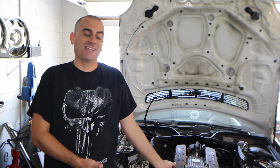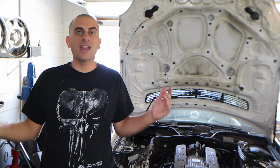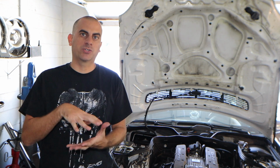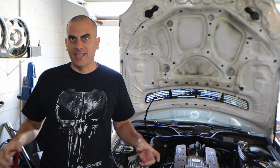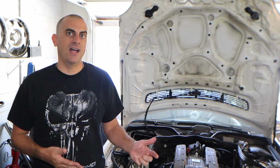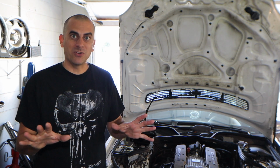But unfortunately, I cannot drive it around. I mean, I physically can, but I do not want to drive it around with no filter, no nothing, because if anything gets sucked in there, then I'm going to damage it just for a cool sound. Originally, I was just being an idiot. I thought I could put my mushroom filter back on. I can't. It's literally a different throttle body, different size. So my other options, I'm going to shop around a little bit and see if I can find something online. But what I'm 99% going to keep is what I'm going to be showing you guys today.